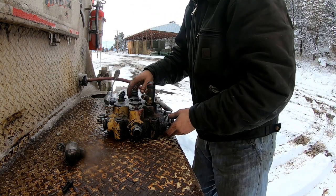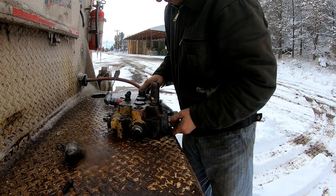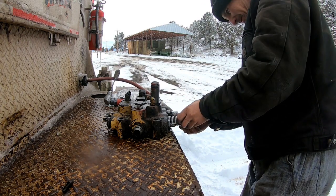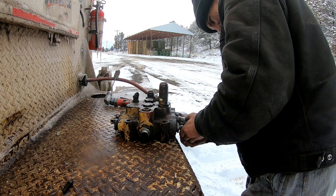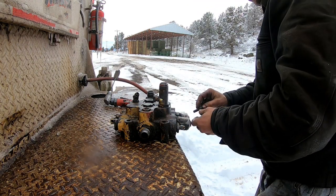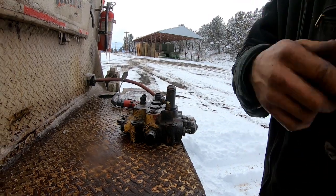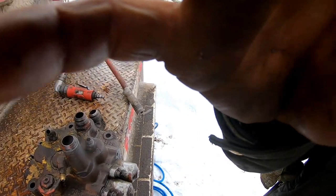Hanging there. I think that was the problem, unless this backstroke valve was hanging. We'll take it out too, but I gotta take this other spool loose. Okay, guys, I'm gonna polish this other spool and charge the battery on the camera. See, it's down to like 13%.